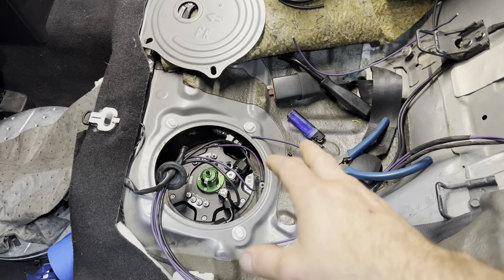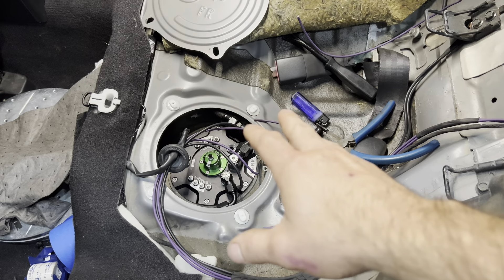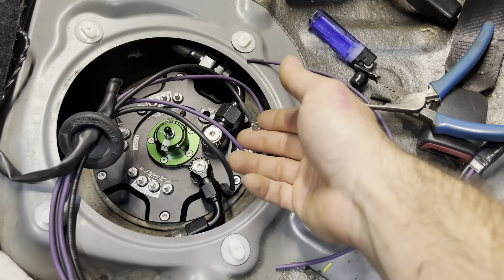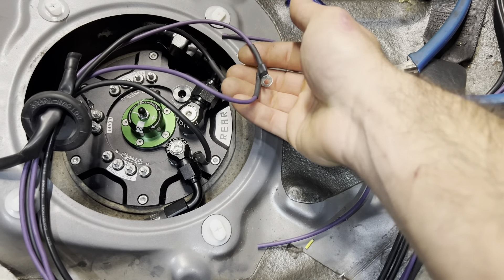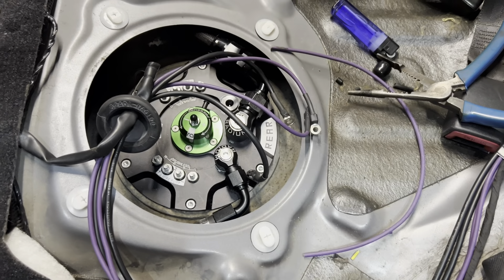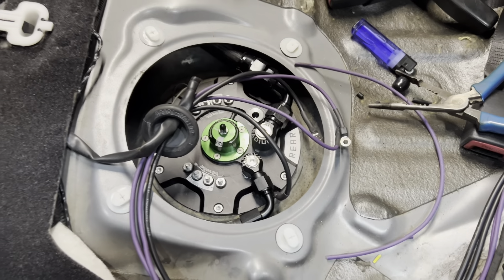Since all three are wired on the same relay trigger, the key is to test them one at a time by leaving the others unplugged. I'll keep the individual pump power leads away from anything that could ground out, wrap the ends in electrical tape, set them aside, then come back and apply power with only one relay plugged in at a time.